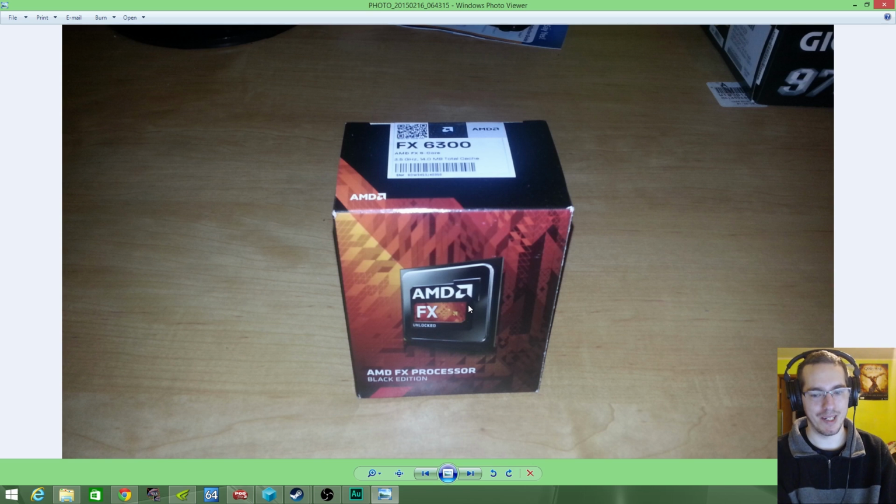I mean, going from maybe 10, 15 megabytes max read or write, just because that's how slow this stuff runs for him. He's going to be going from that to 120 gig SSDs rated on a SATA 6 chipset, or SATA 3 chipset, 6 gigabit. You know how fast that's going to be? Holy crap. I mean, he's used to doing something and then going off to do other stuff around the house because of the fact that the computer takes so long to load. And I've told him, once this thing gets built, once I'm done with it, you're not going to have that extra time. You're going to click something and it's going to boink.